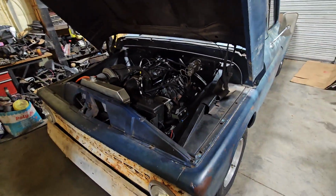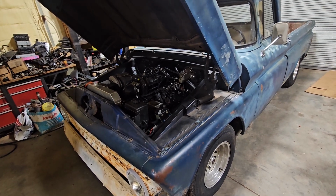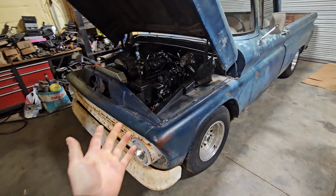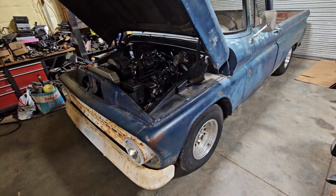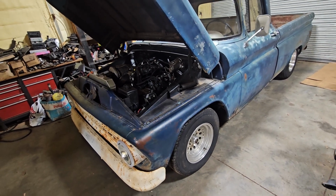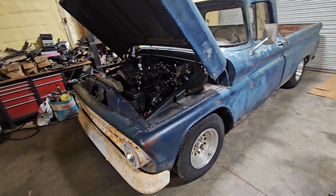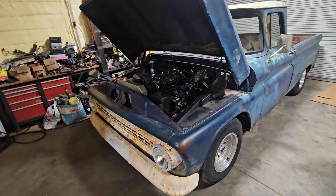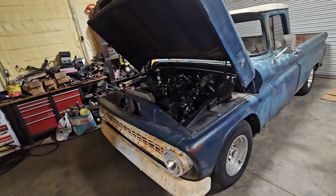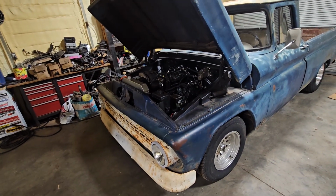I had 2 fuel pumps running off the same tank, and then the second fuel pump with a check valve and everything, so neither one of them would backfeed each other, and that worked out pretty good, except my secondary pump was an inline 750, I think it was, the MagnaFuel 750 pump. So when it came on, it was just a huge inrush of fuel, and it took some time with Michael tuning everything to get it dialed in, with both pumps running, to have a nice smooth transition into the fuel curve.